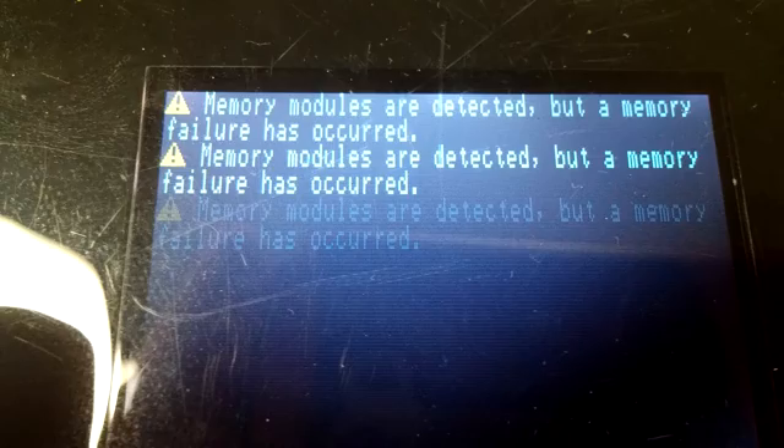They delivered it a couple days early, so they're good on transportation. It works, I have no problems. I was lucky enough to find RAM with the name of my computer in it, so I knew it was going to be compatible. When you go into the comments on Amazon, you can ask questions — put your computer in there and ask, 'Will this work with my desktop?' and you'll get answers. If there are no reviews or questions answered, don't buy it. Even the people selling the product can answer those questions — if they don't respond, they don't really want to sell it and you don't want to buy it. Make sure it's compatible — that's the biggest thing.